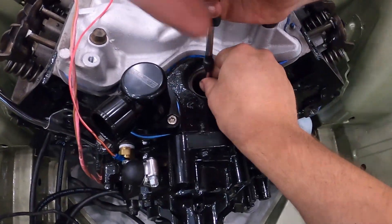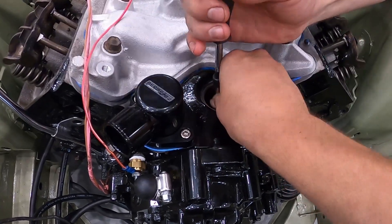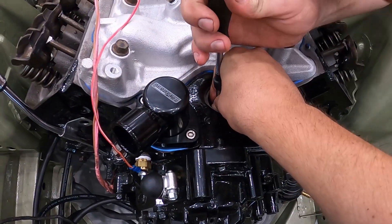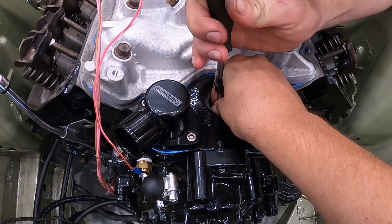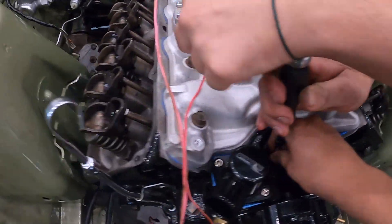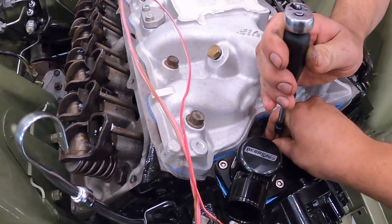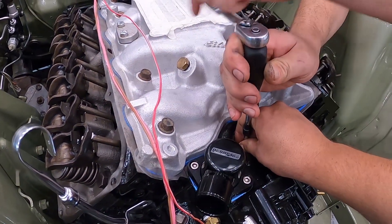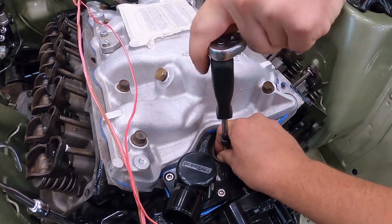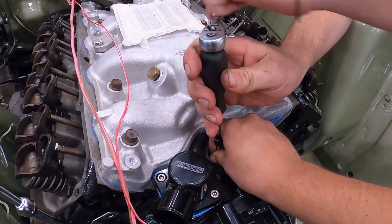So we'll get this in there gently. If you look down in here you'll just see the top of the oil pump drive shaft. We want to get this on and start spinning counterclockwise. There is a special tool you can buy for this, but if you're pretty steady there are a few different techniques. You're trying to purge the air out and the oil in, so you can go slow and steady. I found slow and steady works a bit better than going too fast - people use a drill but there's really no need. Keep an eye on the rockers for the first signs of oil coming through the pushrods.